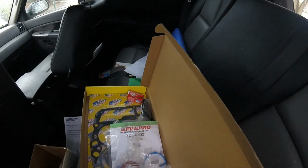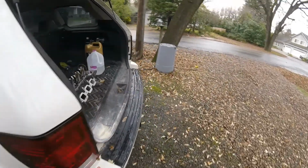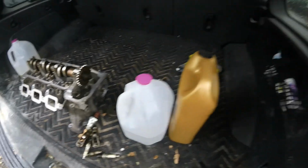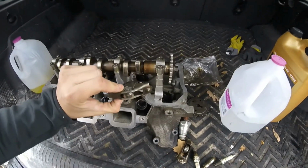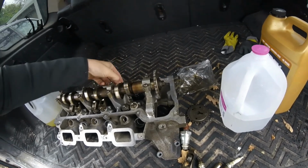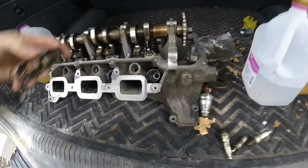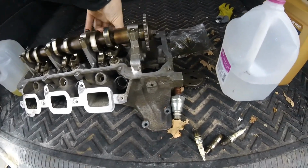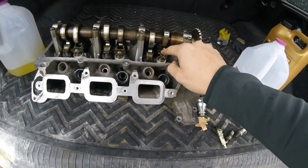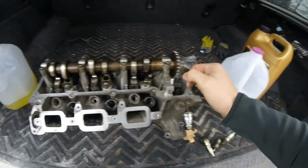But anyways, what happened when that valve got stuck, it rocked away in the intake, rocked away, fell off, landed on the other side of it, and knocked the other rocker arm off, because they're not bolted on, they're just pressure and hydraulic, so they're held on by that. Starting to rain, so where's those valves? So here they are. So here's the valve that fell off. Not fell off, but the one that first came off. It was right here. This one was this one right here. So it rocked off. See, it's basically on right now. It's horrible. So it rocked off. It got stuck, rocked off, fell over to the side, and the cam lobes hit it and pushed this one off.